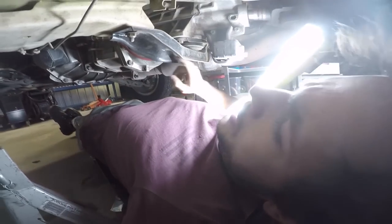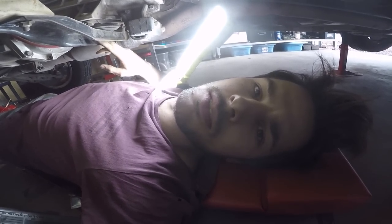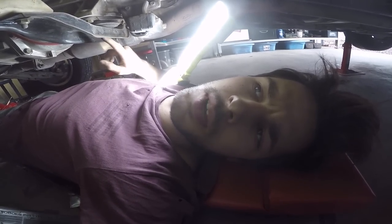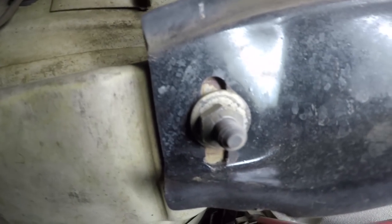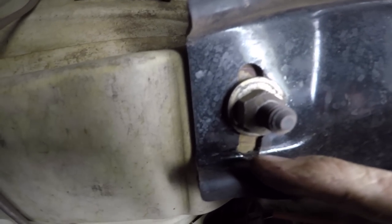Now, a couple of people have asked what I did for mounting. I don't know if this is standard XF or standard E-series crossmember. I'm pretty sure it's standard XF crossmember, but don't quote me on it. Regardless, you're going to drill an extra hole in it. So what I did to make it work was I slotted these holes. So they've been slotted, and you can see I brought the slot just down to here.